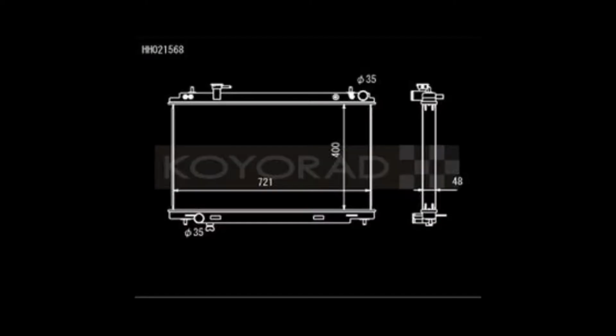I'll catch y'all later. Alright, so it's been about 3 weeks since I did this video install on the Koyo Radiator. Couple of things I want to point out. I initially mentioned that this was the 53mm thick core radiator, but I would like to make a correction on that. I did a couple comparison pictures, and it is the newer version 48mm thick Koyo Radiator. So I just want to point that out. Regardless, this radiator is still bigger than the 36mm core radiator that Koyo Rad sells, and it's definitely a lot bigger than the factory radiator.